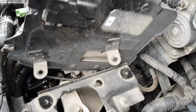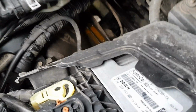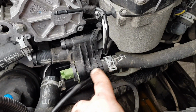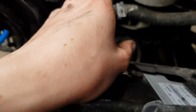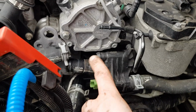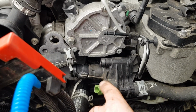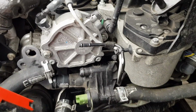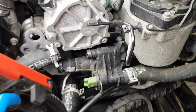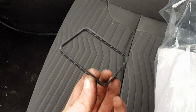And bolt it from underneath the tray. But as you can see, there's all the coolant. And that's where it's all been. So what we need to do now is obviously get to this clip and that clip, and then get to these little bolts. I'm not sure you can see, there's one there, there's one underneath here, one there, and one around the back. Four little bolts holding them on, and then we can get the thermostat out. Bear in mind all of this for that.